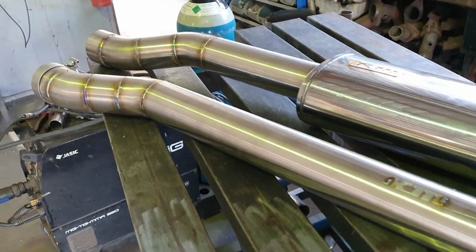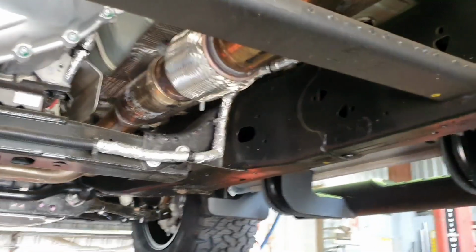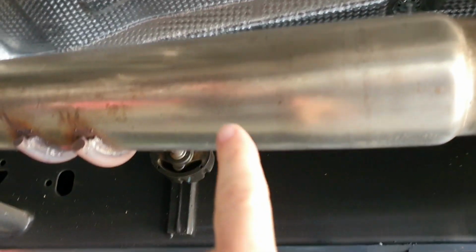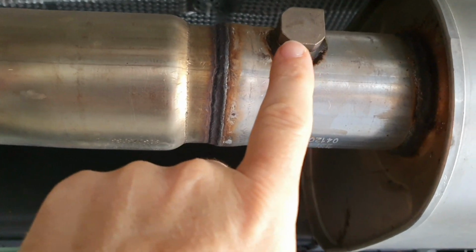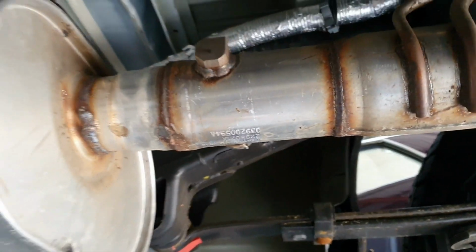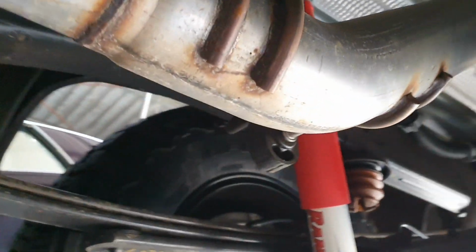I'll quickly show you what we're working with under the truck. Alright, we come off the front in the Y pipe. The cat converters are at the front. It does have a large flexi in it. Comes down in here. Funnily enough, this is all 409 stainless, and then they switch to aluminized. It's our standard muffler assembly, and it's got these valves, which once we cut it, I'll show you more on them. Like I say, it's all one piece. There's not actually a joint in the system.